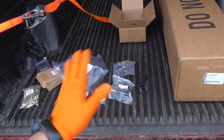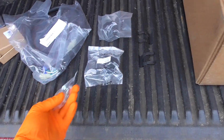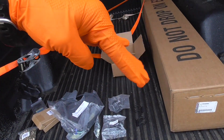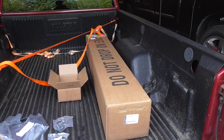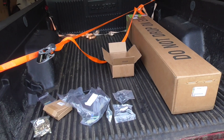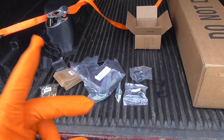I'll be showing the part numbers and how-to for all the GM parts. When I get everything painted I'll replace these with GM ones because I don't like the quality of these too much, but temporarily they'll at least keep me legal while I fit the rest of the body kit. I also got new clips since my old ones were rusted. This kit comes with plastic clips that you'll actually need for this bumper. You'll also need little rubber feet that go into the bottom of the bumper where the license plate goes, because you only bolt in two top bolts. It's pretty much a bolt-in — you can bolt it or weld it, whatever you want.